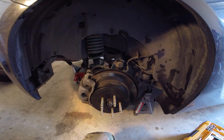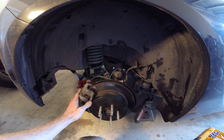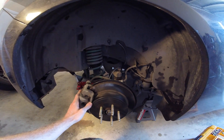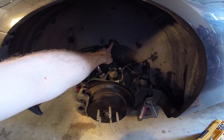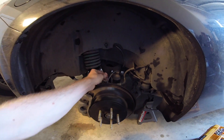With the tire off, we can go ahead and examine our hub. This is the rear right speed sensor that we'll be replacing — it's the same thing on the rear left as well. This right here is your speed sensor. It goes all the way up into your trunk via this cable here, and there's a little 10mm that attaches this to the hub.